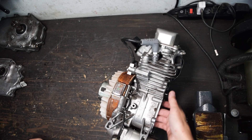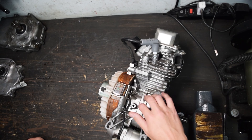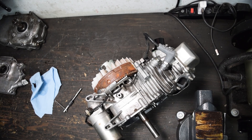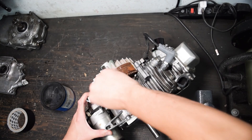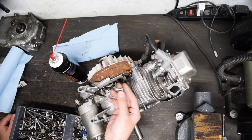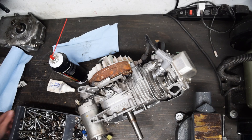What I'm going to do is clean the underside here and put some tape on the back, then tap through here — that should contain most of the metal fragments. Then I'll flush out the crankcase using brake cleaner to make sure I got a large majority of the debris. I'll probably also put grease on the tap as a secondary way to catch anything that comes free. I remember doing this on the GC series engine on the Bonanza minibike and now I remember it's an M7. I'll throw some thread sealant on it and thread it in.